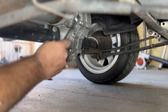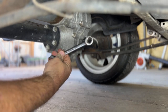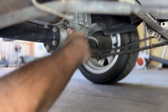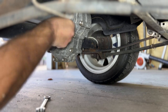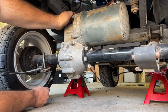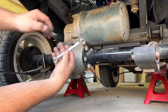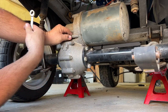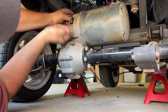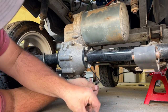Before we can remove the motor from the transaxle or rear end, there are four bolts to remove. The first one is right here — grab a half-inch wrench; in my case, a ratcheting wrench. We're going to save this hardware and reuse it once the new motor is back in place. Three bolts are on the top and take a 7/16-inch wrench. There's one on the lower front that takes a half-inch wrench, and I've already removed that one.